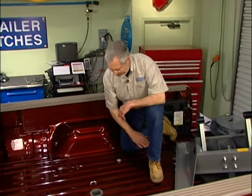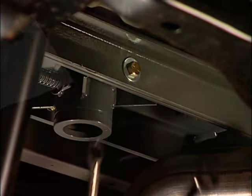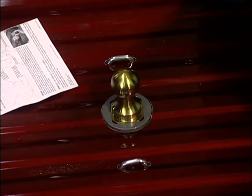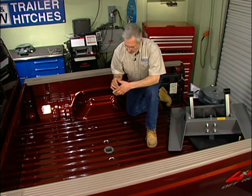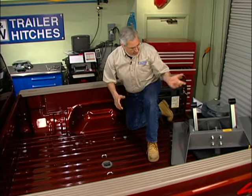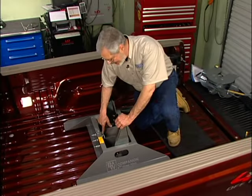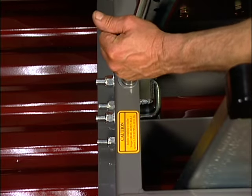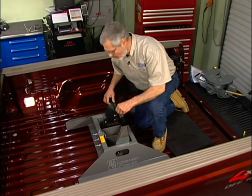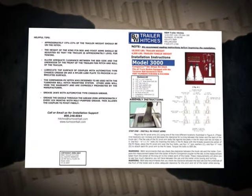Here's what we start with — look at this truck, nothing in it, the bed is nice and flat. In less than an hour I installed all of the substructure under the bed. That's the hitch — it's a good, rugged unit, all American steel, made in the USA, finished well. With the attachments available from B&W you get seven different hitches. What we're going to install now is the base of the Companion fifth wheel hitch. There's one critical sound and one critical thing you need to see as the mount post goes through. Once that happens, you've got to get out and engage your latch pin. Once the latch pin is engaged, following the instructions, torque the mounting bolt to 40 foot-pounds — that makes it nice, tight, and quiet.